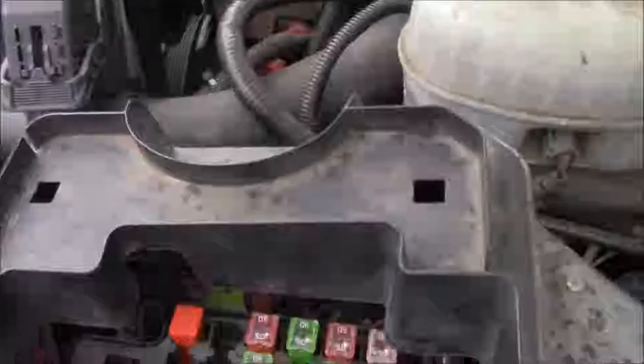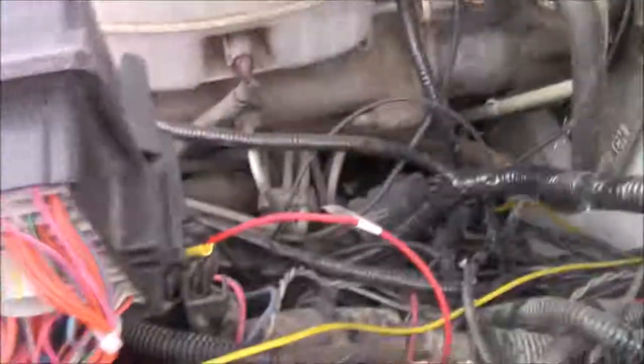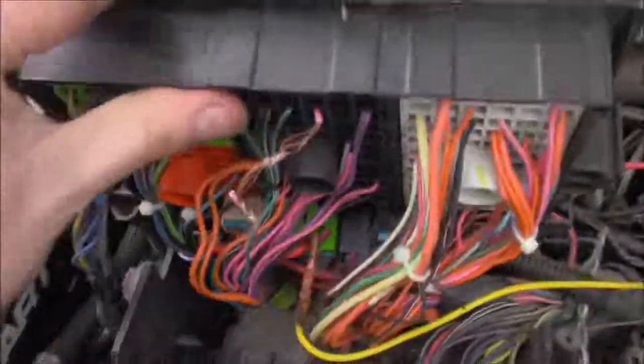Next thing: pull the fuse box cover up. This is done on an '05 — the 2001 to 2007 and LBZ will be similar; I think the '01-'02 have some things in a different spot. Peel back this tab and lift up the fuse box — you want just the fuse panel showing. It comes up on a hinge, so don't force it or you'll pull some wires. What we're looking for is this green junction plug right here. You can see two green wires coming out of that one pin — that's where your nitrous trigger is going to come in. McRat already T-tapped it.